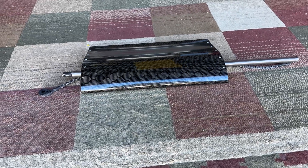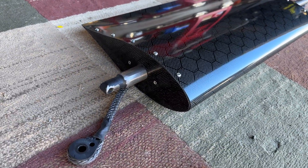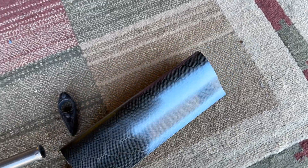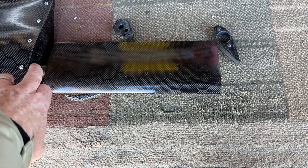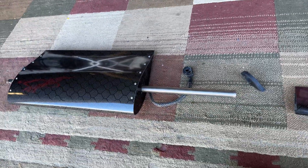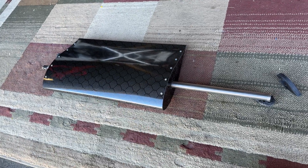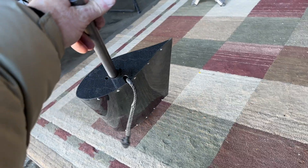So the basic fairing kit for the shock comes with the main section with ribs on either end, plus rivets to fasten the top rib to the shock T. They're beautiful and well made. There's also an optional shaft fairing for the bottom piece. If you have safety straps, it's probably best to just get the main section because the safety strap does not go through the bottom fairing. This fairing fits the 1¾-inch, 2-inch, and 2¼-inch shock, which is the Carbon Cub, so it fits any Shock Monster shock up to 2¼ inches.